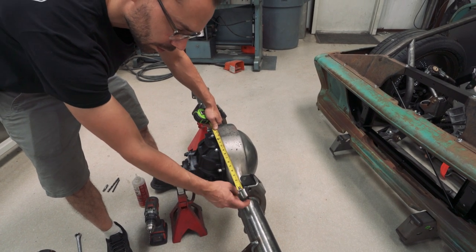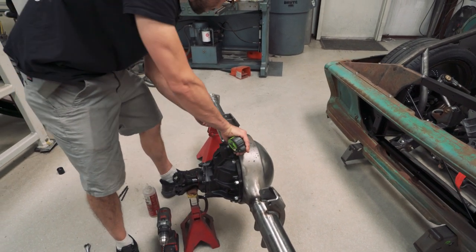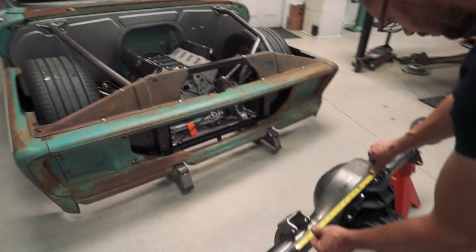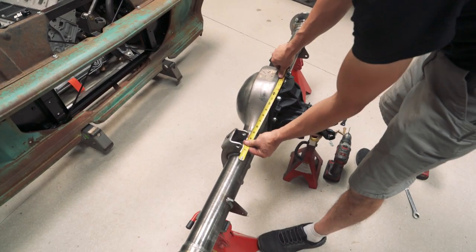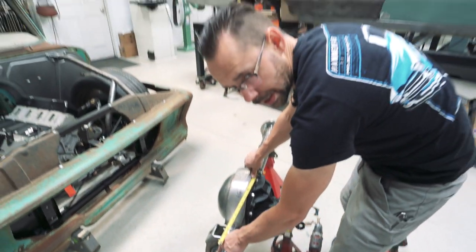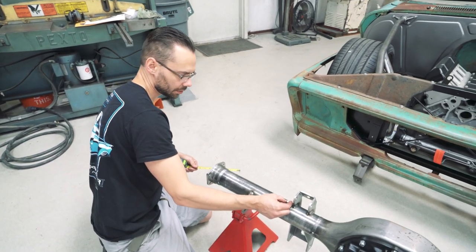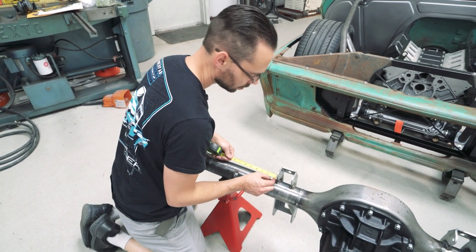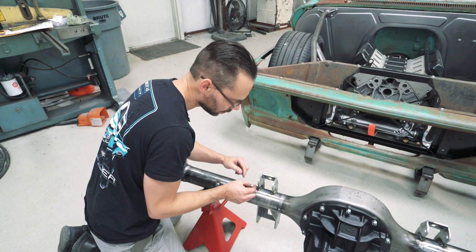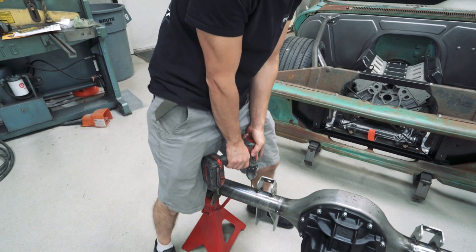We need to be in roughly a two-inch zone on the outside of that bracket - 14.5 inches going this way from the rib. Same thing - two inches from that bracket. We're going to mount it one inch away from that bracket and we'll be good to go, won't have to worry about it contacting the frame. I want it dead center on the rotation - top dead center. Drill the eighth-inch pilot hole first.